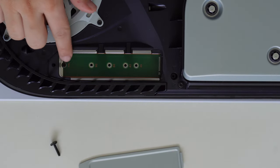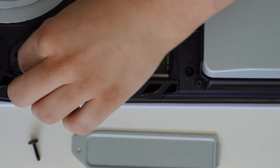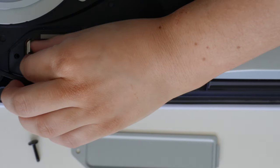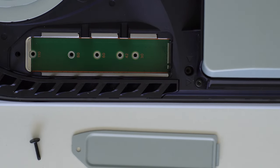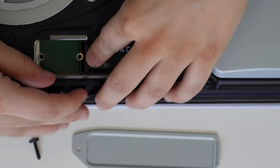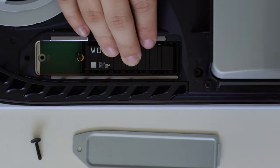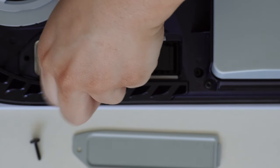There is a screw on the inside that you will need to unscrew, and it will have a little nut in there. This is to screw down your SSD and also to size up where you want to fit your SSD. The WD Black SN850 NVMe SSD fits with size 80, so you can place the nut in the 80 hole and then slot your SSD into the right-hand side. The SSD just slides into where the pins are, and once you align them properly it will sit in, then you put the screw back in so it doesn't move around.